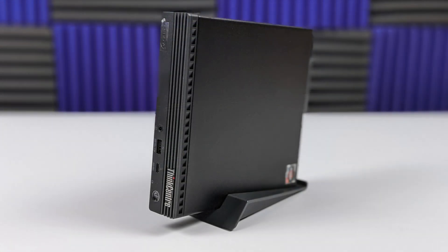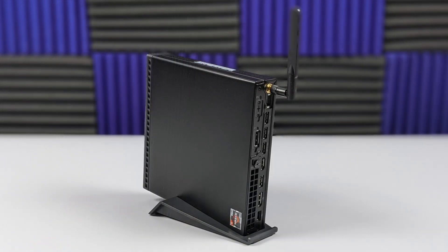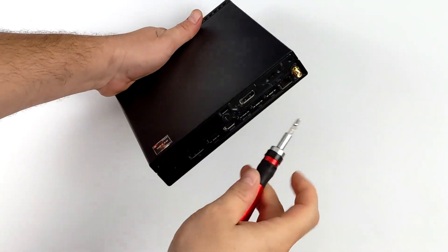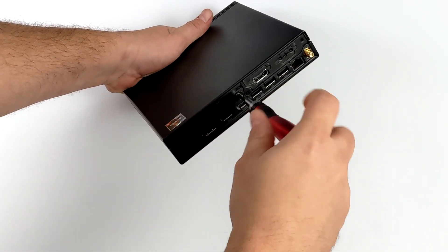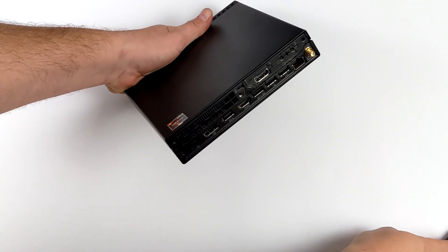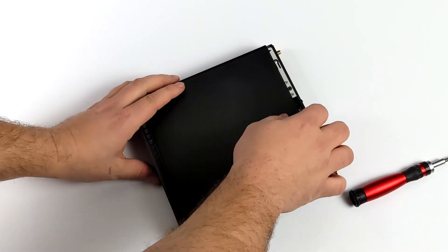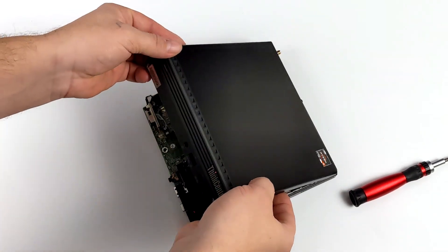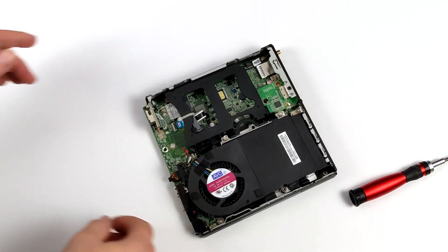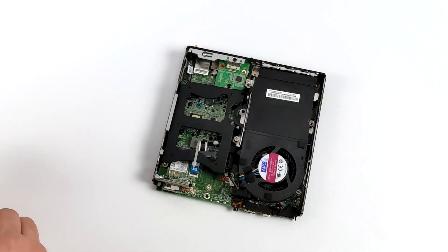And like we saw with the unboxing, this does come with a stand. The unit that I ordered actually has eight gigabytes of DDR4 running at 3200MHz and a 256 gigabyte M.2 SSD — it was the cheapest version they had that used the 4650GE. But I have 16 gigabytes of DDR4 running at 3200MHz laying around, so I figured I'd go ahead and upgrade it. Plus, I definitely want this running in dual channel, because that'll significantly increase the performance of the built-in Radeon graphics.